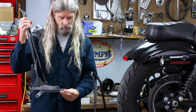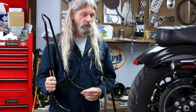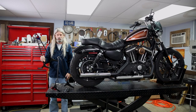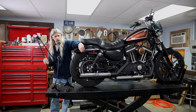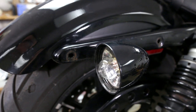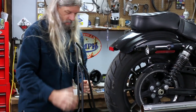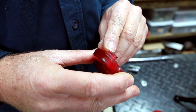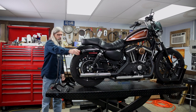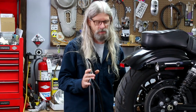You're going to take your new sissy bar. You'll notice you don't have to relocate your turn signals — you're just going to put it on there. I also took the lenses off — just popping them off. If you look on the lens, you'll see it has a spot with a slot right there. When it's on, you can just stick a flat head screwdriver in and pop it right off. Ten seconds — however long it takes, just get them off.